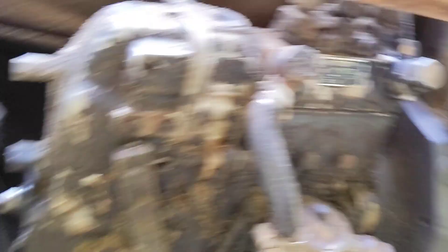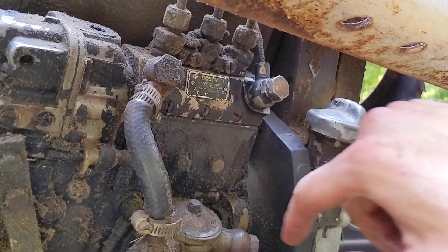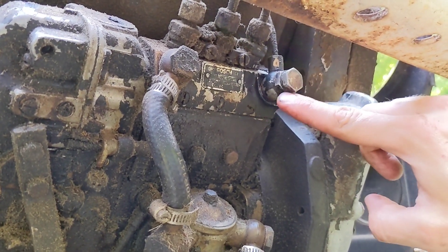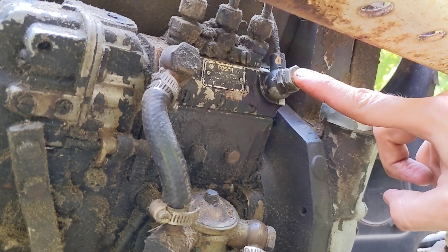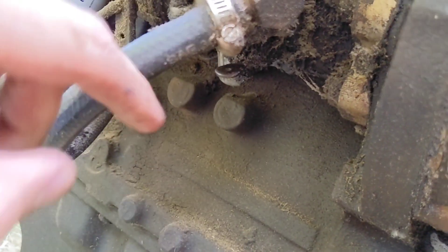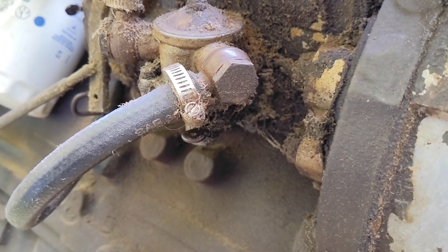And lastly, looking at the injector pump here, you have your input line — as evidenced by the low-pressure tube — and then your output there at the high pressure. You can see I got that all cleaned up around there, got the gunk off. We're going to be loosening this bolt, and it'll actuate this bleed lever here. Let's go ahead and get those taken care of.